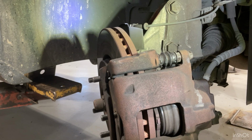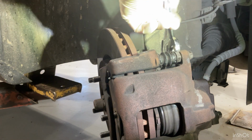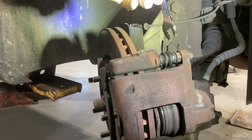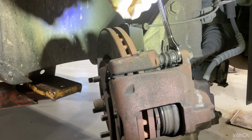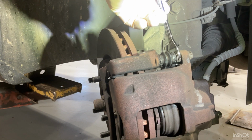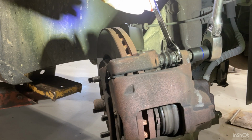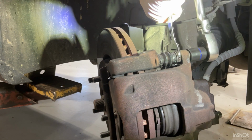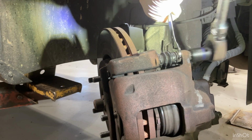Just to show you one more time how a regular 15mm wrench is not going to fit in there. It's going all the way around it. Now I'm going to put my OSLA 15mm on. Go straight in. Even got a little bit more room. So now that being held, I can break that bolt here. No trouble at all.